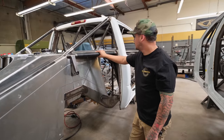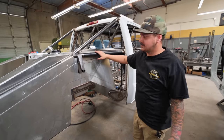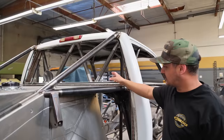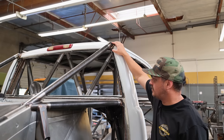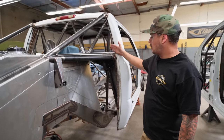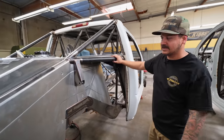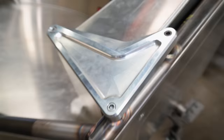This top panel is one big piece. A lot of other trucks are a little different in layout, but on this truck since the shock mounts are so far in we didn't have to do any structure here for the shock mount, so it's pretty much wide open. I decided to go with a miter on the back of the cab — I haven't done a miter down bar in probably ten years, but since the whole back of this truck has zero bends on any of the tubes, we'd keep that theme going and just miter it so everything flows nicely front to back. It's got our billet fuel cell hold-downs on the top middle and rear corners.